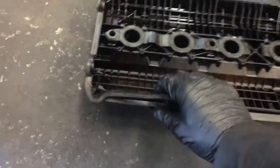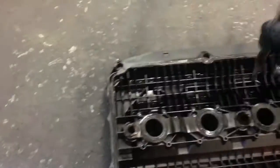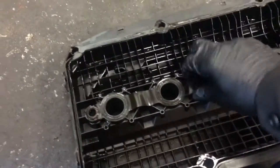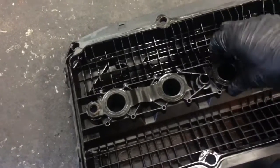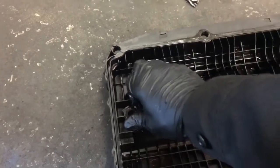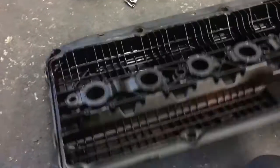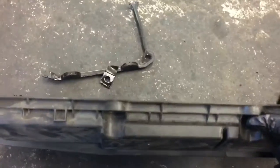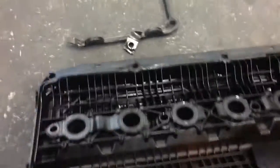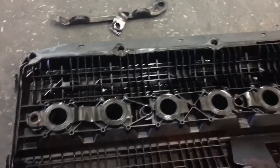After getting the cylinder head cleaned up, remove all the old gasket from the valve cover itself. They have tube seals in the middle, so you're going to change those out as well. As you can see, the valve cover gaskets get rock hard and brittle, which is why they start leaking. Remove all that, then wash the cover up. Also check the valve cover by looking down it to make sure it's not warped — it shouldn't look like an airplane prop. If it's really warped, I recommend you replace the valve cover itself.